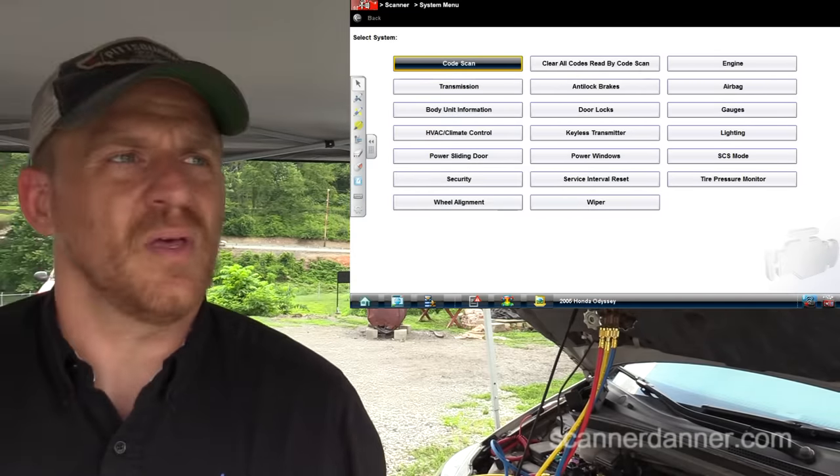This tool takes the place of the relay. When I hit the on button, I have current flow passing from one terminal to the other. The nice thing is it provides a current loop where I can do an amperage measurement for that clutch. It's got its own 15 amp internal fuse. I need an amperage measurement here — we'll use an amp clamp with our regular multimeter.